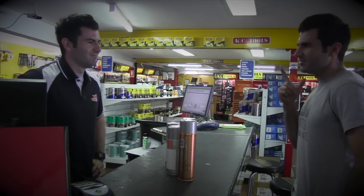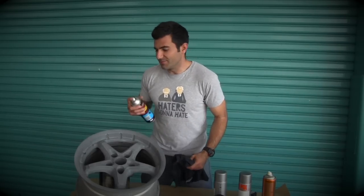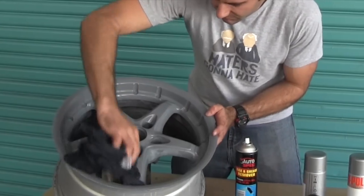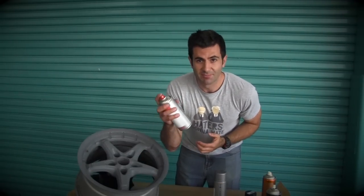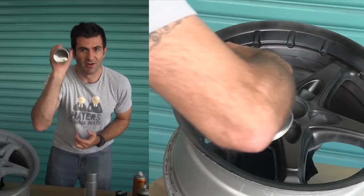Hey, you know what? You look familiar. Where have I seen you before? Yeah, I used to be a plumber. Alright, I've got all my materials, now I'm ready to start painting. An important step in painting is to be sure that you clean your product before you actually put the paint down. I'm going to use a wax and grease remover — just spray it on and wipe it off with a dry rag. Now it's time for the base coat. I'm going to use a black base coat first; that's going to give us the best effect with this pearl. I'm just going to spray it on, do about 3 coats, waiting 10 minutes between coats, and it should be dry.